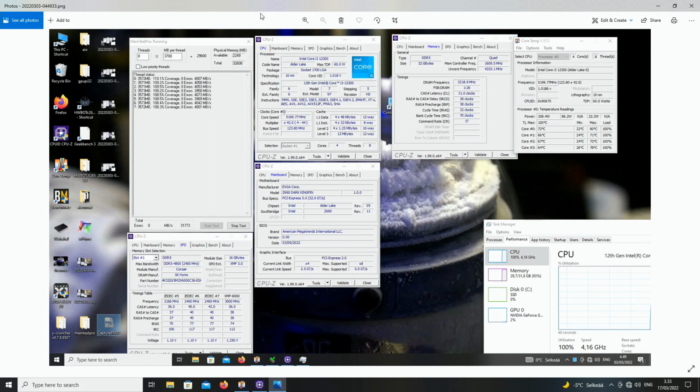But this was completely HCI memtest stable, so roughly the whole capacity was being used, and most of the subtimings were at auto though. But then, based on this result, if I couldn't go any higher on the frequency, I would just tighten the subtimings and get this configuration tighter and better performing. So that's what I just wanted to say. So that's pretty much it.